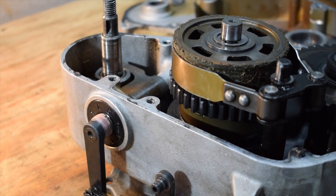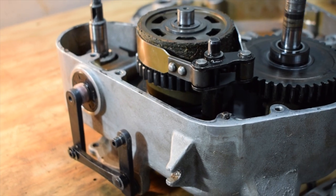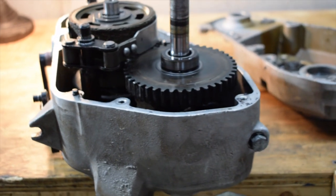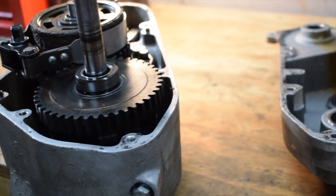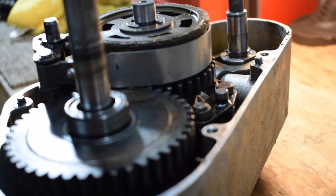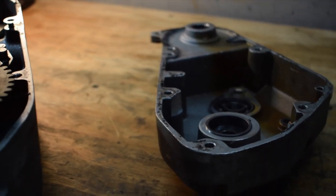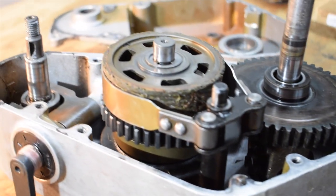I hope this gives you a little bit of insight on how these gear cases operate, so that if you're going out looking for a machine to buy, you'll have some confidence in buying one that may need some repair and save a lot of money. Unless something catastrophic happens inside the gear case, more than likely the two clutches are the only wearable parts. If you have a reel mower that isn't going when you engage the drive, it could be as simple as a stretched or misadjusted cable. With a little bit of knowledge and process of elimination, you can figure out what needs to be done to get that machine operating properly again.